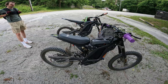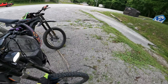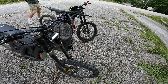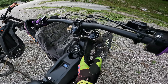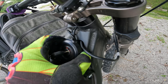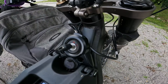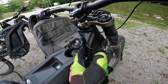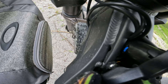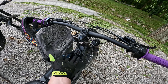The first point is how cheap the plastics are on this bike. Everyone talks about the back and front fenders — those are obvious. But not so obvious: I broke the front piece off from running into stuff and it just snapped off. More importantly, the ignition plate right here — you can see it's hanging off with wires out. It's supposed to be screwed in, but because the plastics are so cheap, when we installed the BAC 4000 we accidentally over-tightened the screws, and after hitting jarring bumps the plastic just ripped out of the holes. You cannot over-tighten these bolts.